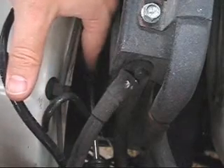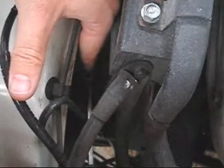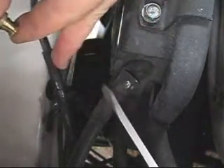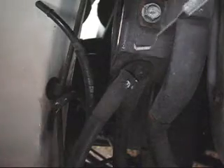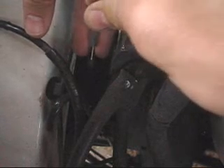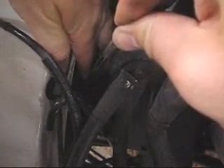Here's the top of the air spring. I've got a flat-head screwdriver and we're going to put it in between the top of the air spring and the bottom of the rubber grommet, twist it slightly so it pops up. Now we can get at the brass grommet. The O-rings are still in there, so we need a tool to fish them out. Here's the tool I use — it's a dental tool I've modified. You just need something to get in there and hook it. Make sure it's not too sharp — you don't want to damage the O-rings or inner walls. I'm dropping this down in there to catch one of the O-rings; there are two in there. Pulling the first one up and gently tugging at it.